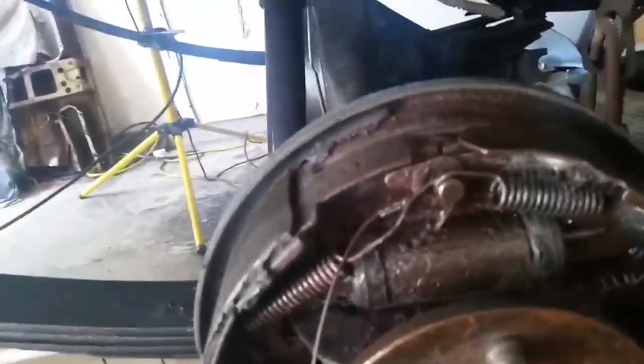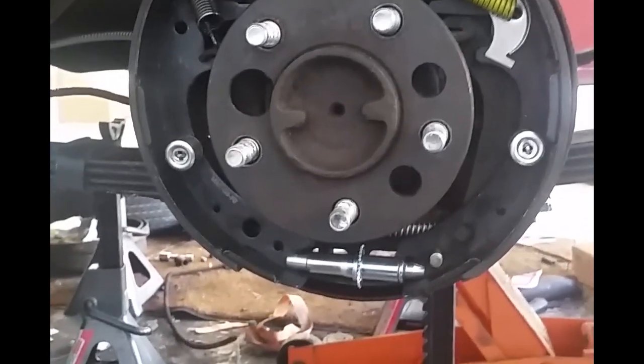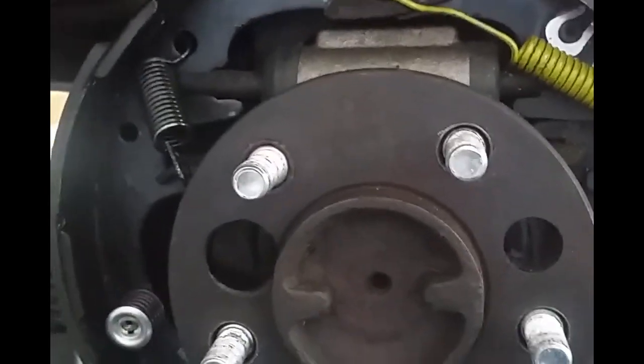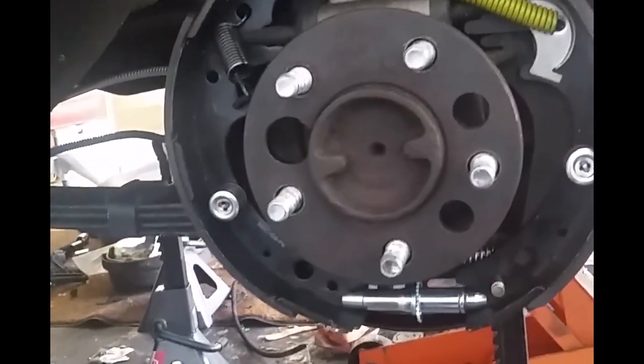On this next part you'll see the finished version — all shiny new parts. This is the driver side; you can see I replaced all the studs so they're right-threaded again instead of reverse thread. For some reason on older Mopars they used reverse thread. Glad they stopped doing that because it was ridiculous, but this will have regular thread so if I ever take it to have the tires replaced they won't freak out.